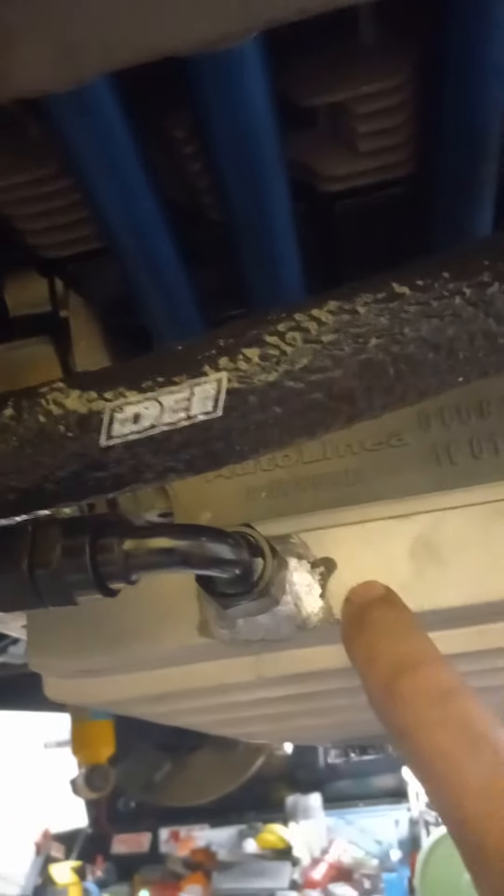The other port off the filter mount is the bypass. This one's coming off the filter — basically bypass — and this is overflow, or after it's regulated pressure, this is the extra. It comes down, makes a loop, and goes right back into the sump, where it just bleeds off the excess.